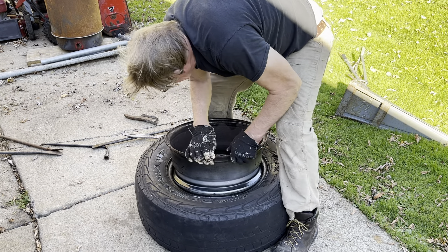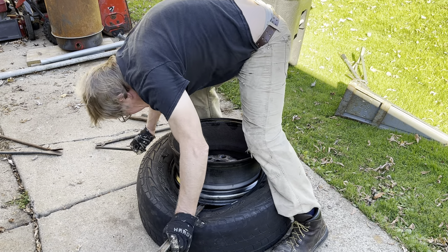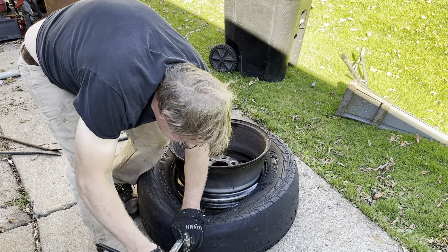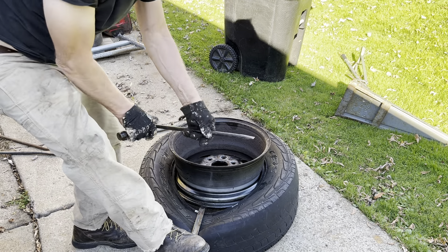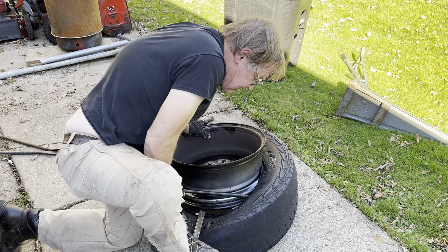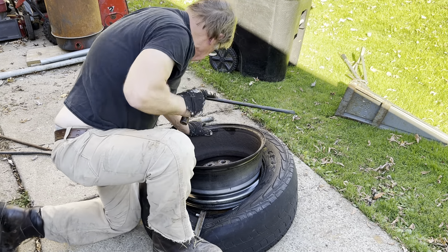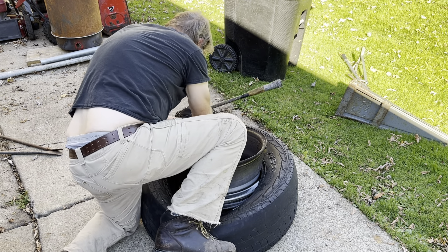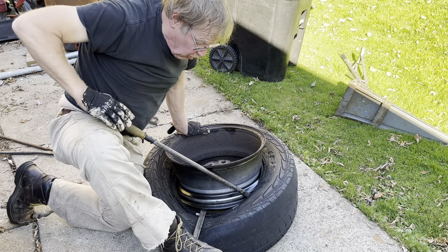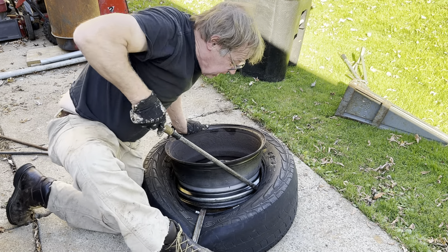Make more excuses Randy, have another brew. All right, we got it now. So you hold your foot down here, you push this in and kind of pry and twist and you get the thing to come off. Push up that way and you get a bite on the wheel. Keep going around a little bit at a time - don't get too greedy and take too much or you'll never get it.